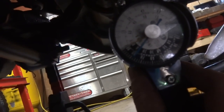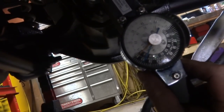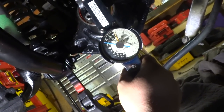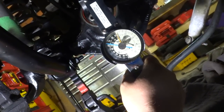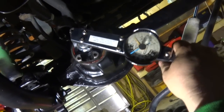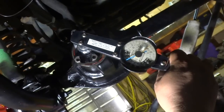I got that set on 40 — I'm right at the max, maybe 41. But I'm not going to mess with it. Before I check my gear pattern, I've got to make sure my pinion and differential preloads are the same. My pinion was at the high end like 40, 41, and to turn the differential you need another 7 to 11. So it should be like 47 inch pounds to turn this differential. And right, like 47, 46 — that's right.